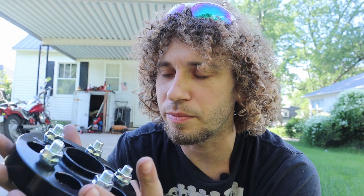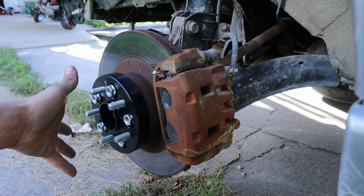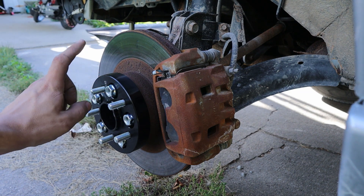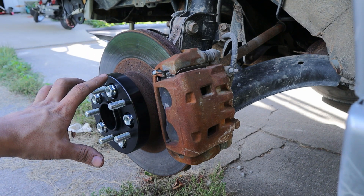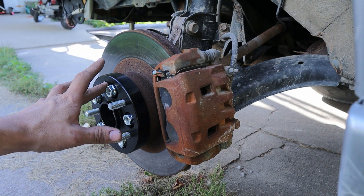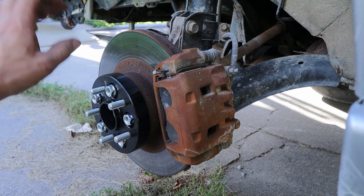There's not a whole lot of danger from using wheel spacers. The reason I am only going one inch, or 25mm, is because you're putting a lot of extra stress on your wheel bearings. A lot of people have said they've gone a little bit bigger than an inch, but you start going bigger than this, you're going to start wearing out your wheel bearings extremely fast.